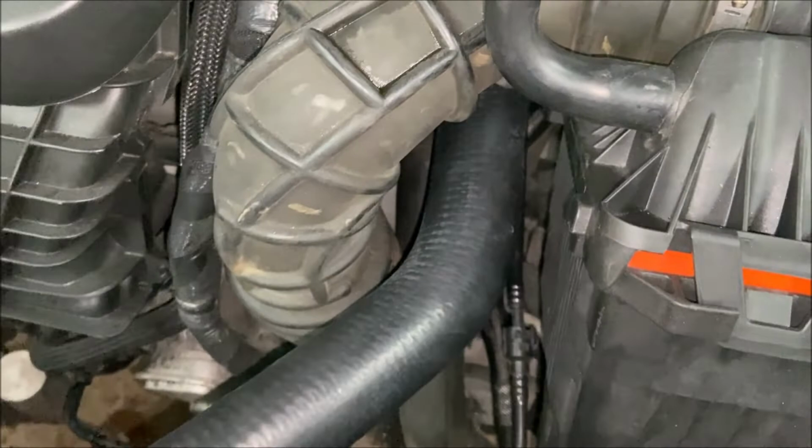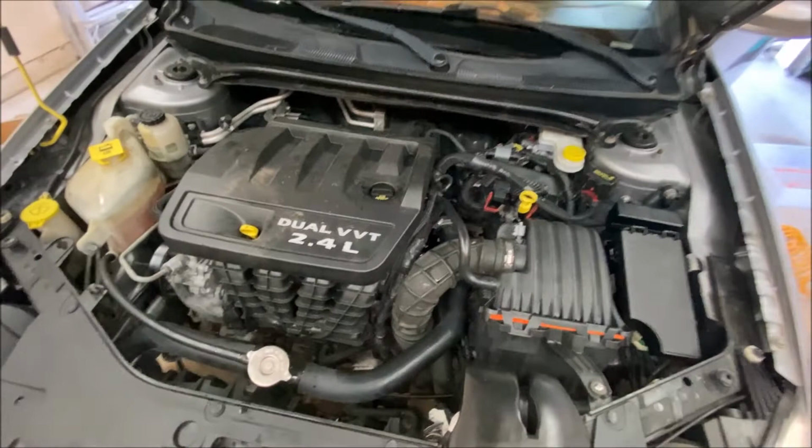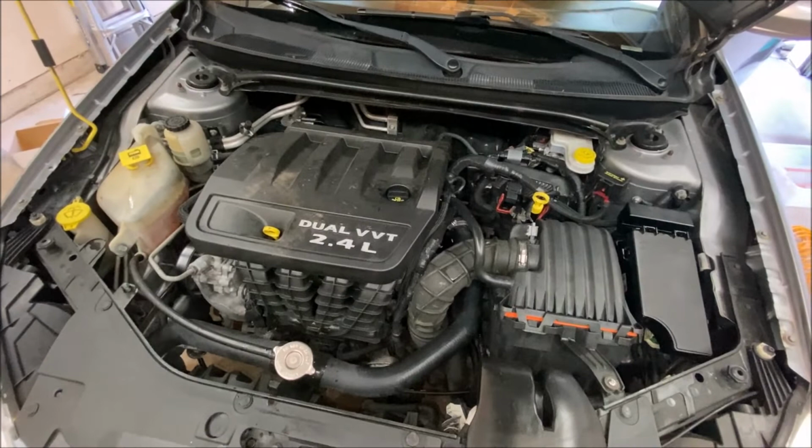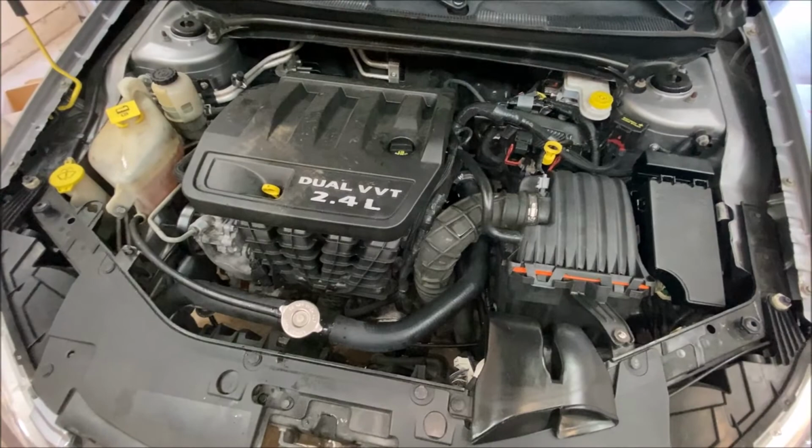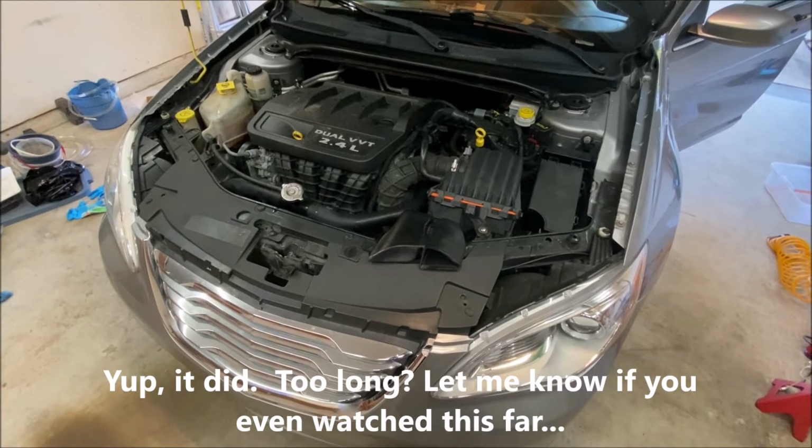I don't know if every Chrysler 200 with its 2.4 liter dual VVT is like that, and it just runs cool. Is that a thing? Leave a comment if you know that that's how these things go. But at least I know that the thermostats are good, the coolant temperature sensor is good, the engine has good cooling, and so this video may turn out a little bit longer than it really needs to be, but I learned a few things along the way.